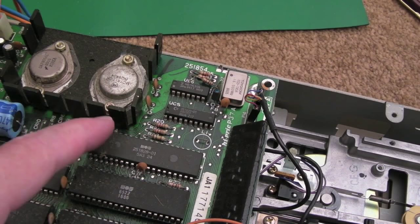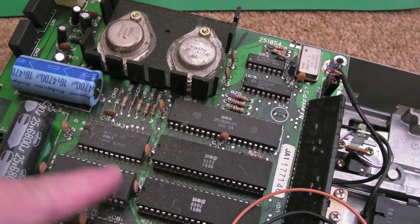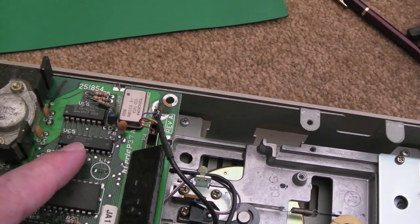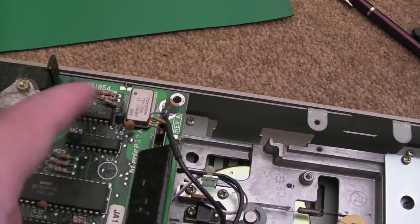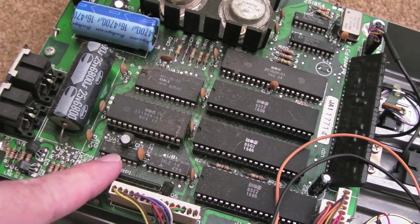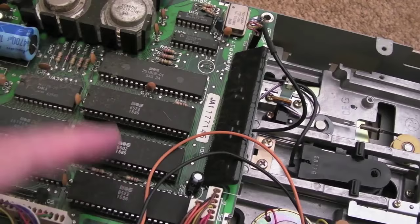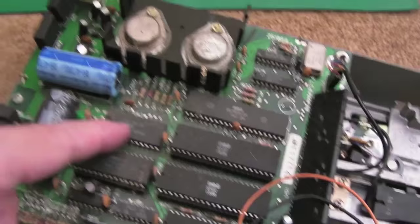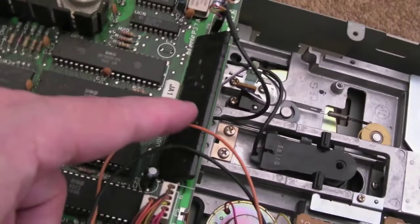Not sure what this chip is here — I'll put some text up in a minute. There's Oki RAM down here, probably SRAM. This looks like the ROM, socketed. Then just a couple of supporting logic chips: one has 'Commodore' on it — near the clock, so probably some sort of clock generation IC. There's a 74LS06 and a 74LS14. Standard off-the-shelf parts mostly — you could replace the 6522s with Rockwell chips, replace the CPU, replace the ROM. The RAM might be tricky to find an exact size, but you could adapt something similar.